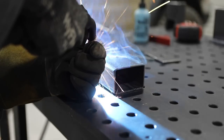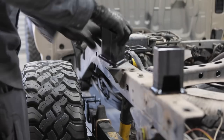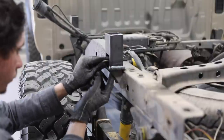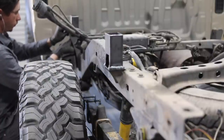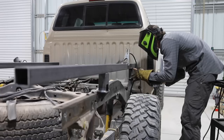What I'm fabricating here are the truck frame mounts. The canopy will sit on top of these mounts and bolt directly to the frame. The nice thing with this canopy is that if I ever wanted to take it off and put it on another first-gen Tacoma, you just lift it off and drop it on another one and everything should line up.